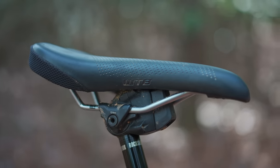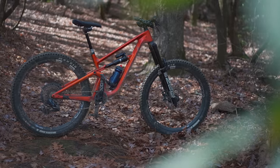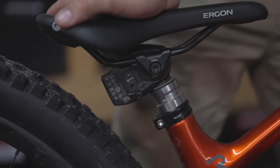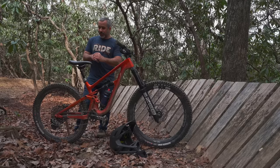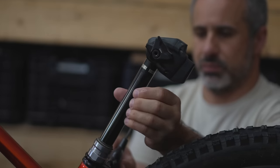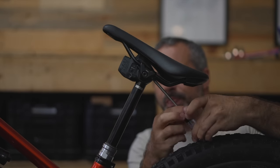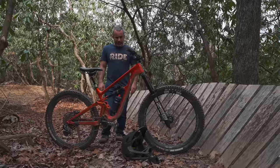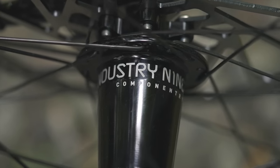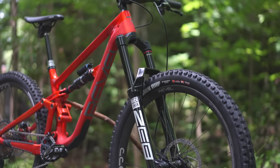There's a really weird story about the dropper post. As you can see, the battery is on the front underneath the nose of the saddle. Normally with SRAM AXS the battery is on the back, but because this is a size small, when I went off big jumps and drops and bottomed out the rear of the bike, the back wheel was actually hitting the battery and ripping it out. In the end I just hacksawed the limiting screw out from inside the dropper post, spun it around, found a saddle that would clear the battery — perfect solution.